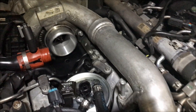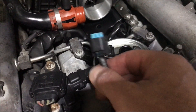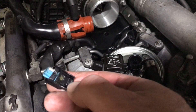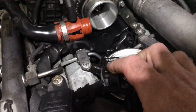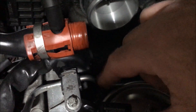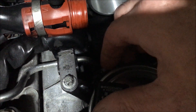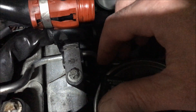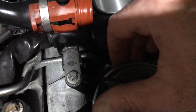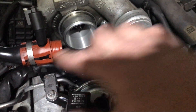I'm going to start unplugging the water sensor here — just a simple squeeze of the end and this will pop off. So that's out of the way. You can see the bracket that holds this in place back here has a clamp with a five mil hex head, so we're going to try and undo that. That should open up enough for this to slip out without undoing the brackets. If it's stuck or I'm having too much trouble wiggling it, I'll just undo the three bolts to lift it out.